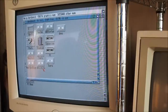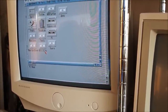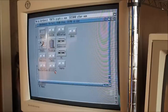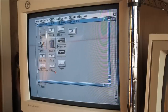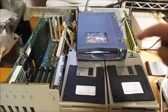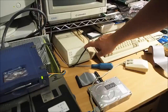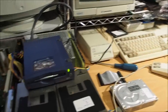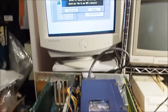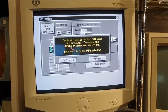hard drive. So, considering that I don't really want to play too much with that drive because it belongs to the 2500 build that I've got, I'm going to try another couple of drives just to see what I've got there. Remember the zip drive from the previous video where I actually get that booting on my Amiga 500 over here via the SCSI port here on the A590. I've plugged that into the back of the GVP A4000 card, the hard drive controller, and lo and behold, kind of as expected, it's picked it up on ID6.